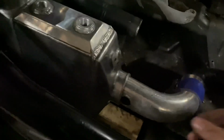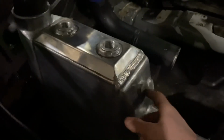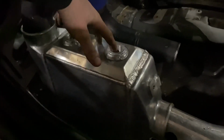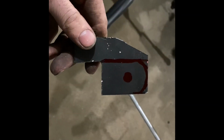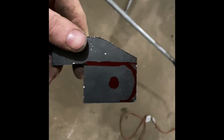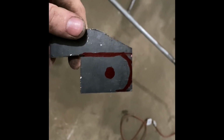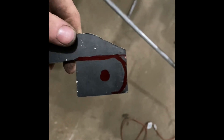So I'll show you what I'm going to do with this now. I have some 3/4 steel there, so round 2. I'm probably just going to run a beam here across there, and the same here. Probably use some 1/4 inch tabs or something, some good grade 8 bolts, and mount that. So yeah, I get this plate drawn out. It's 3/16 I think. It's the size above 1/8 anyway. So basically I'll just cut this out, make one just as a test fit, and then I'll trace this onto another piece of steel and cut 3 out like this.